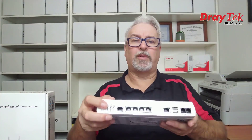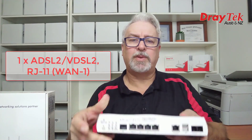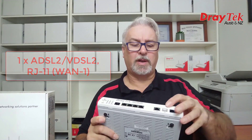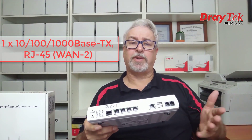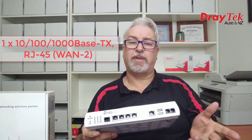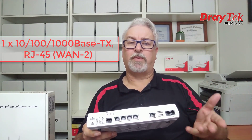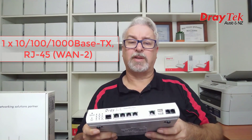In common, they all have a built-in VDSL2 or ADSL2+ modem to work with fibre-to-the-node NBN connections or any type of ADSL in Australia. They also have a Gigabit WAN port which can be used to connect to any type of internet connection requiring an Ethernet WAN port, like cable internet, NBN hybrid fibre, fibre-to-the-premises, fibre-to-the-curb, and wireless and satellite internet connections.